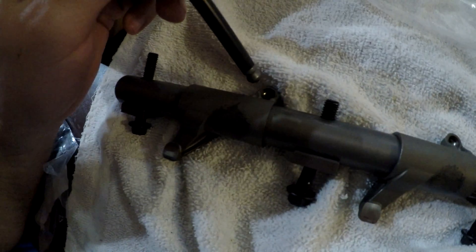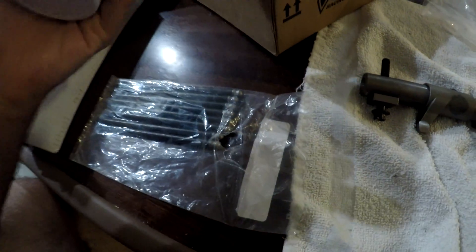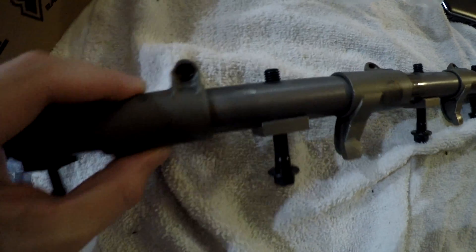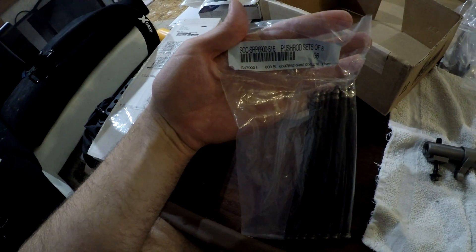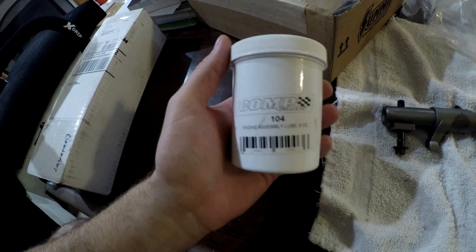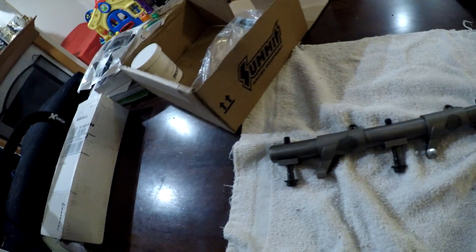You will see a video of it being installed, but right now I'm just showing you what this does. Before you put your pushrods in, you've got to put lubrication on it. You use this cam lube for your pushrods — you put it on the ball tip and it goes right in there. This is by Scorpion, and I will put the link down in the description for you guys. I got this from Summit Racing too, and I will put a link where you can order it.